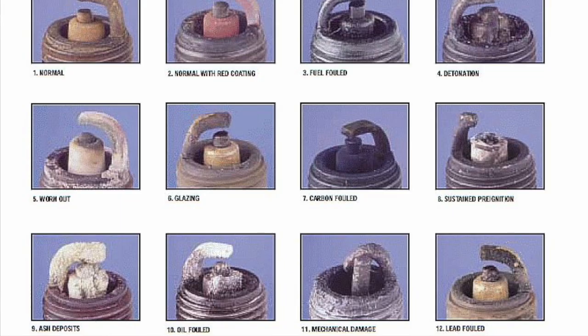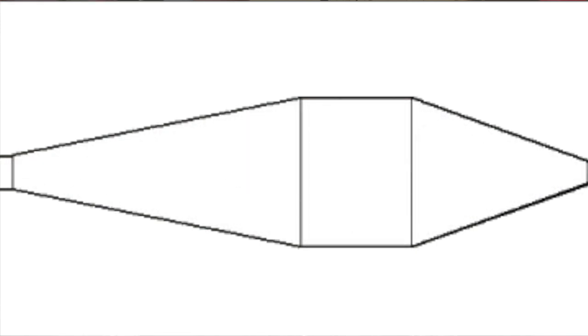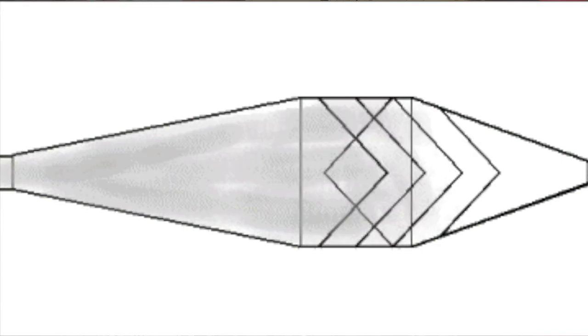Some of you might have seen holes in the piston — this happens exactly due to running lean. On a ported engine, spark plug reading is most important, along with checking the spark plug tip for metal shavings. Once fueling is taken care of, we can improve the efficiency of the engine by using a calculated expansion chamber to ensure unburned gases are pushed back into the cylinder during the compression cycle, achieved by sound waves traveling in the opposite direction at a particular frequency produced at a particular RPM.